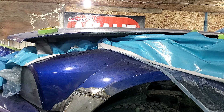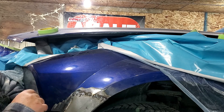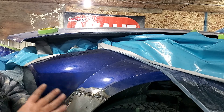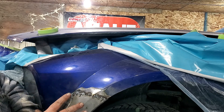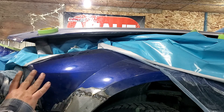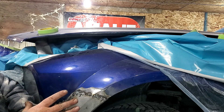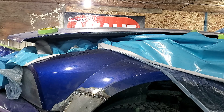Whenever you're done welding, you just want to take the time to grind it off before you put the welder away. Whenever you're putting a patch on like this and you're doing any kind of welding, I like to know I'm going to be in the shop for at least two hours before I leave, to make sure that there's no fires that can start — because a fire in a car can smolder for a long time before it catches fire. So give yourself lots of time.